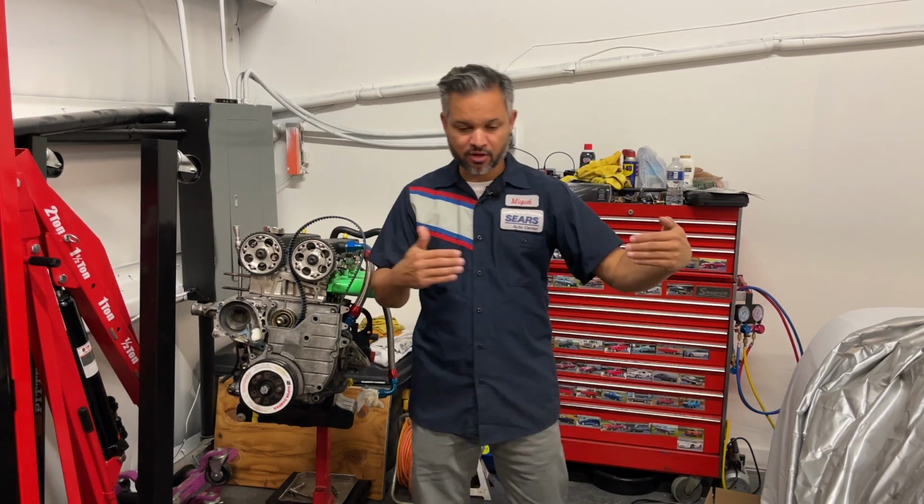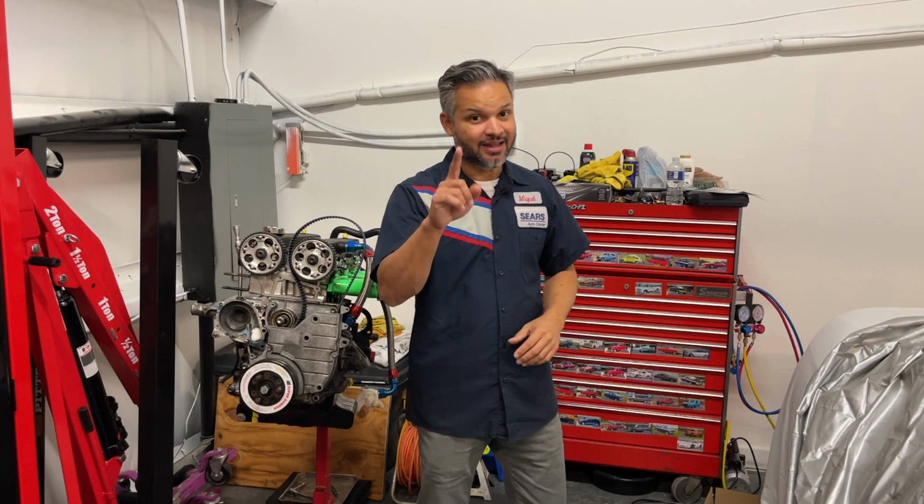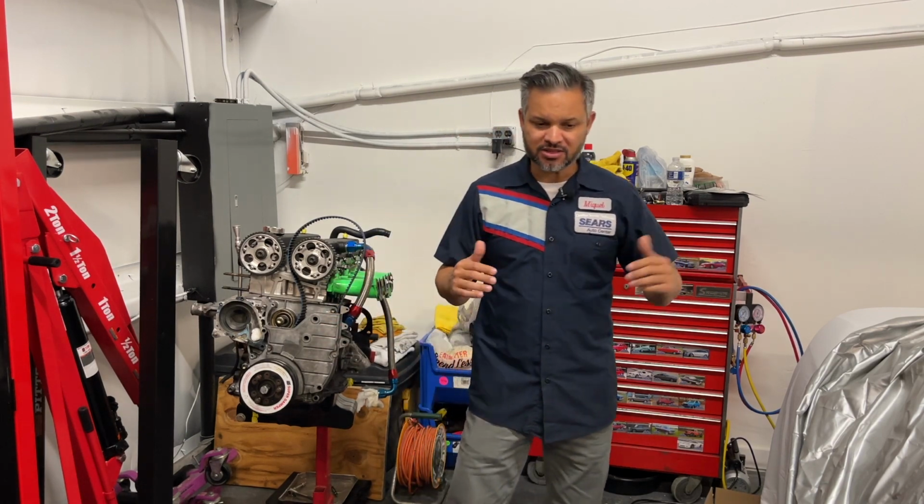I tried lifting the car sideways with the quick jack. Didn't work on this car either. Quick jack is too wide. I did try that on the Range Rover, and the quick jack did work there sideways. So you have to just play around and see if it works for your car or not.